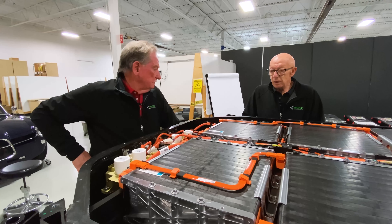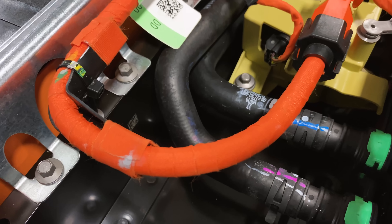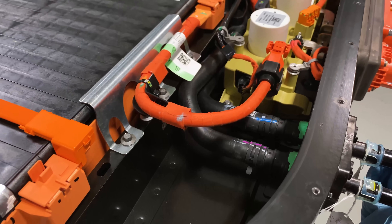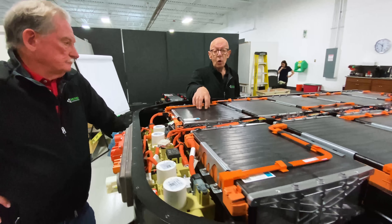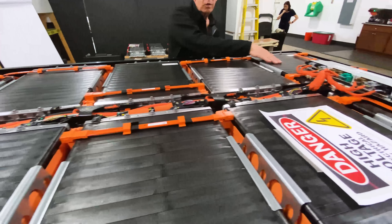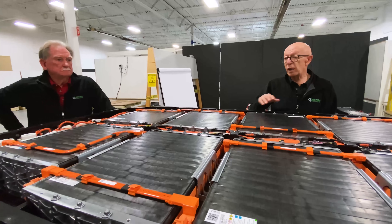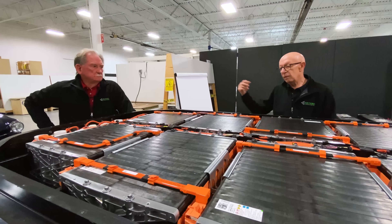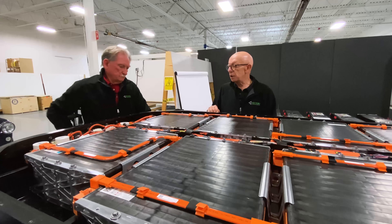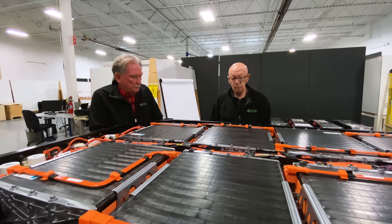The coolant for cooling the battery modules comes in at this position, running down the middle. There are a number of hose connections — a cooling plate for each group of modules all the way down, with coolant lines interconnecting them all rather than one uniform plate taking all the fluid. Every fluid connection is a place to leak, and the more electrical and electronic connections you've got, the more opportunity for a problem.